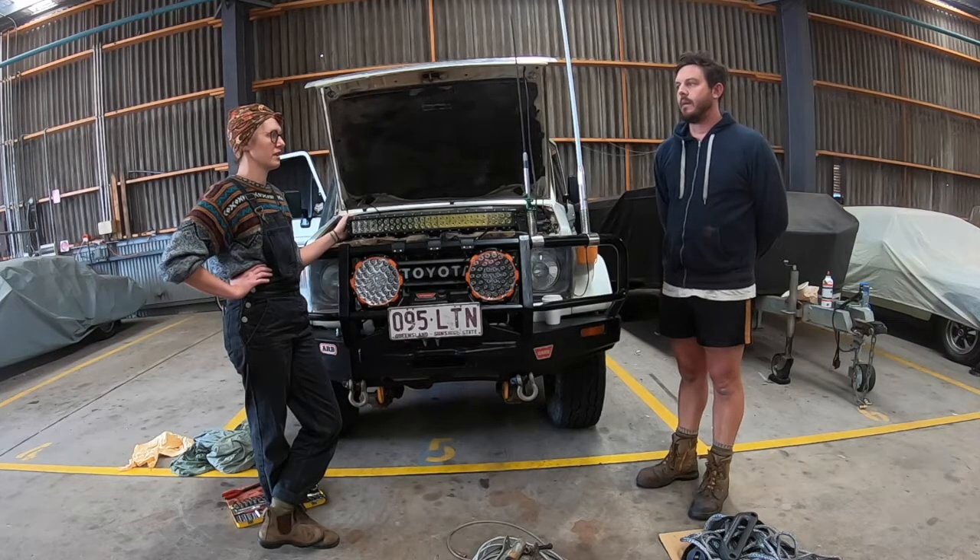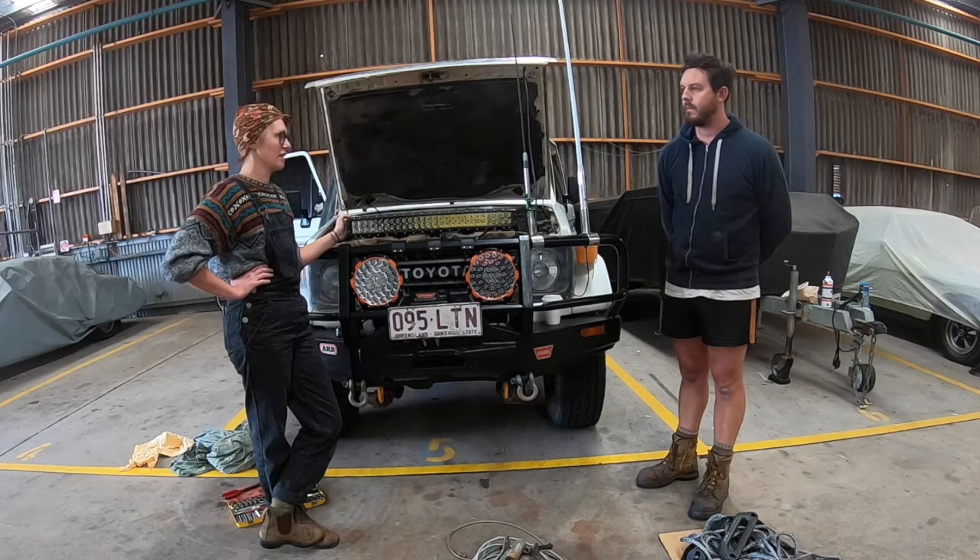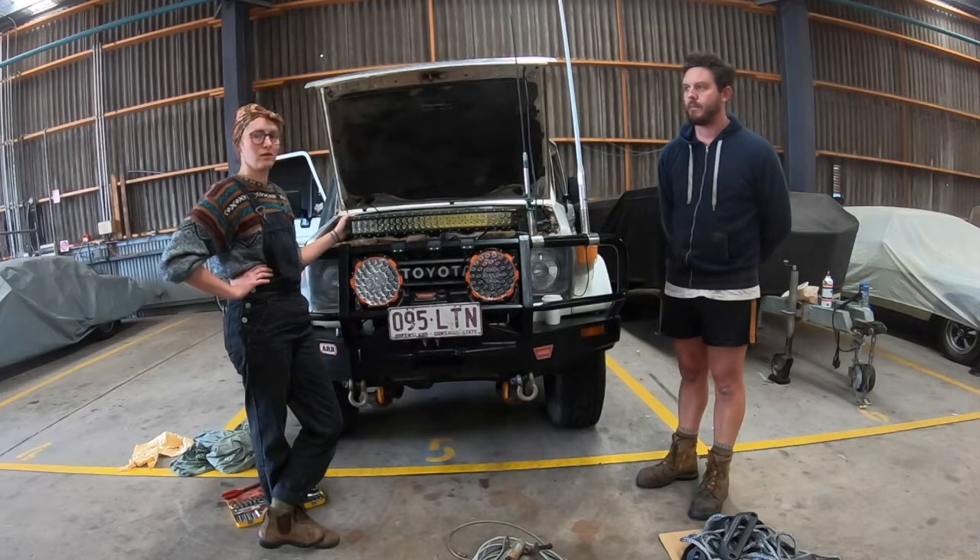As we've probably shown in this video series, don't think that just having a winch bolted to the front is a fit-and-forget item. They do require maintenance and regular inspections. They're out there on the front of the vehicle, exposed to mud, rain, and water when you're going through crossings. They're not as well sealed as perhaps manufacturers might lead you to believe. You need to know what condition your motor, brush assembly, and gear system are in.